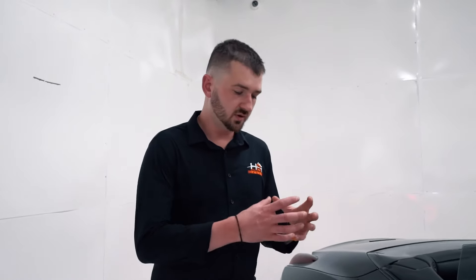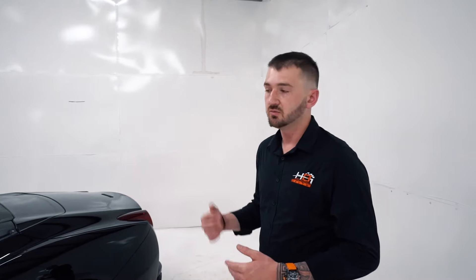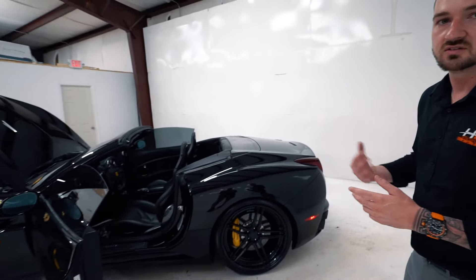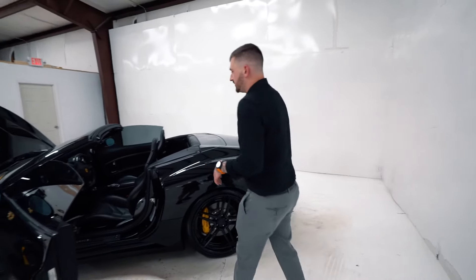Another thing to keep an eye on is the drive shaft. I've seen on quite a few cars where the joint seal breaks and you lose all the grease where the drive shaft connects to the rear going into the gearbox. Ferrari has been known to deny warranty claims on this, calling it normal — but I've had clients who kept driving and eventually had drive shaft failure. Always check that on pre-purchase inspections. On the gearbox: do the fluid services — it will save you headaches because the clutch will wear out regardless. Generally we see about 100,000 to 120,000 miles of gearbox life when fluid services are done correctly.